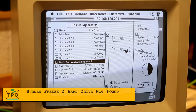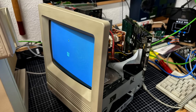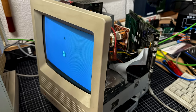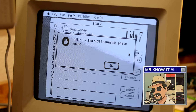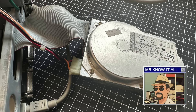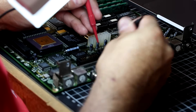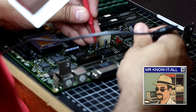But something was still not in good order. When trying to perform some downloads, the SE30 would suddenly lock up, and on the next startup I'd simply get a question mark — not booting from the hard drive at all. Both Apple's HDSC Setup and Lido would report obscure errors. The hard drive seemed dead, but it was recognized fine in another machine. Other known good drives were also not recognized by this machine. I suspected a broken trace around the SCSI ICs — again jumping to conclusions.